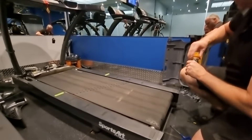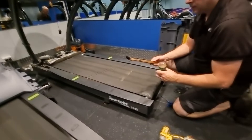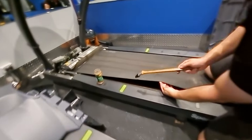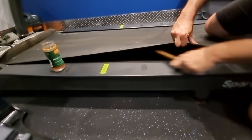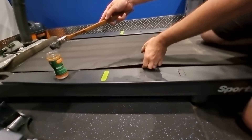What we're doing now is lubricating underneath the running mat itself. This is silicone — I've got it in a generic bottle but it's a thick silicone lubricant. And this is one of those brushes from Bunnings — a particular paint brush with a bit of a right angle to it, which helps. What we'll do is come up from the side, lift up the side of the mat, and put the brush under here with the silicone on it to lubricate. We'll put extra on top of what the automatic lubrication system would do. So you're basically just painting it on to the wooden deck itself.